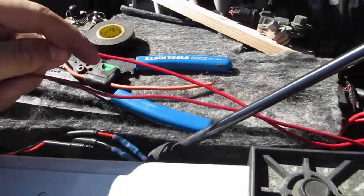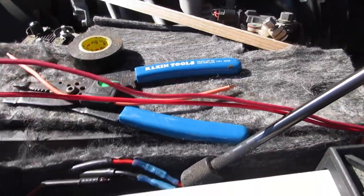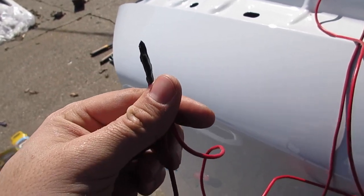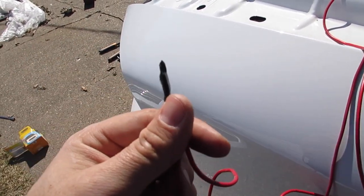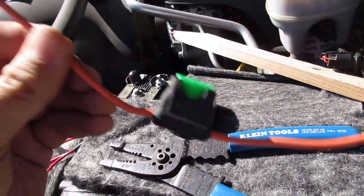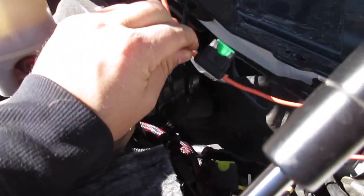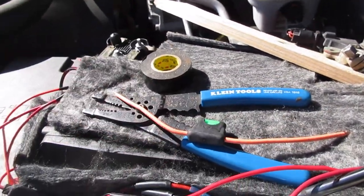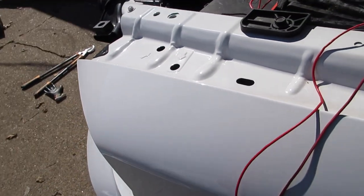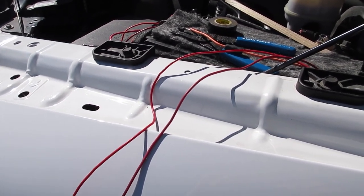This is where your inline fuse would tie in. The one that had the electrical tape around it — whichever one you marked — you'll know which is which. Mine, with the electrical tape on it, is the one going to the lights. So the one that doesn't have electrical tape on it is the one that's going to have the inline fuse ran to it. You can put the inline fuse literally anywhere you want on here — just needs to be somewhere on the positive wire before it ties into the battery. And the other positive wire is going to power the lights. I'm going to go ahead and get these cut in, get the inline fuse in.